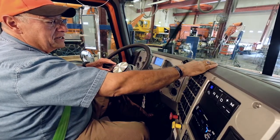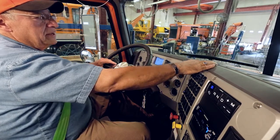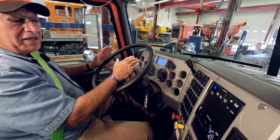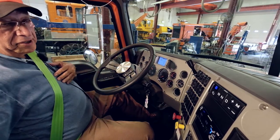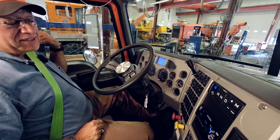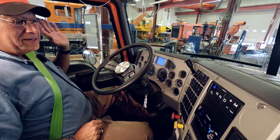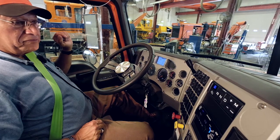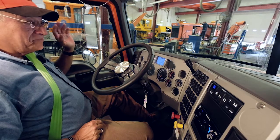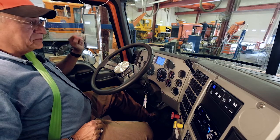You're going to check the fluid for the windshield wipers, that they work. And you're going to check the reservoir. Now, depending on the vehicle, some reservoirs are in the truck with you, some reservoirs are under the hood, and other reservoirs are in the back of the cab. So you have to find where your windshield wiper fluid reservoir is and check that to make sure that you have a sufficient amount of fluid. In the wintertime, this is really important. You will get your windshield very, very dirty very quickly, and you'll need copious amounts of windshield wiper fluid.